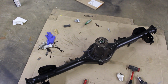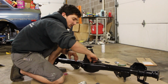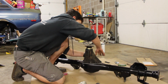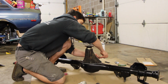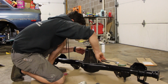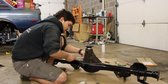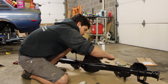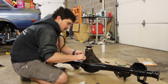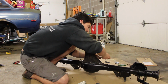Oh yeah, well, let's go ahead and tighten down those bolts real quick on the actual chunk itself. Make sure you do this in a crisscross pattern like you would the lug nuts on your car. That way it evenly distributes the RTV underneath it. Just going to go around and do till it's solid, and then like 1/8 of a turn. And that should be plenty enough torque to hold this in place and keep it from leaking.